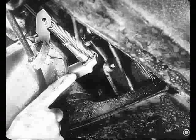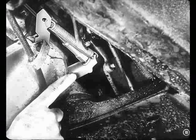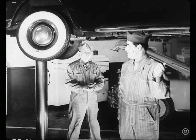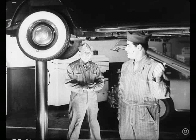How come, Charlie? Oh, this release-bearing fork is right up against the bell house. Chances are the disc facings are badly worn. Is that really bad, Charlie? Well, the clutch is probably slipping a little now. If you run her hard, she might burn right out. I'll tell Bill to get Mr. Johnson, the owner, on the phone. This clutch ought to be looked into before something happens.